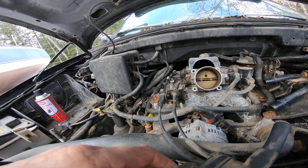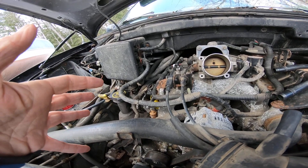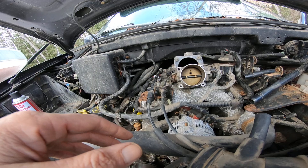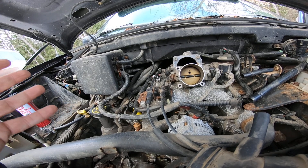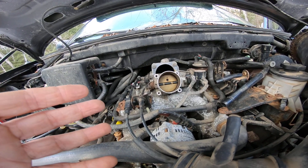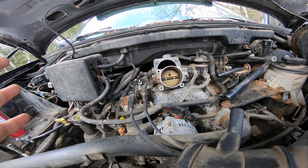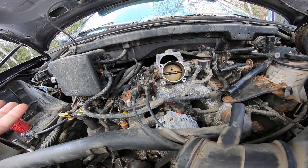When you have that many hoses it can be a real pain to find leaks. For all I know I could have a blown head gasket too — when it ran last year, when you'd step on it it would miss and had almost no power whatsoever, which is kind of indicative of a leak or a blown head gasket. But it could just be the mass airflow sensors, the dirty throttle body, or a combination of everything, plus my exhaust is pretty much rusted off.